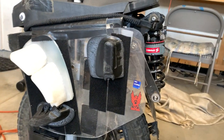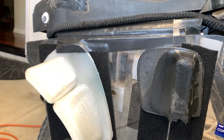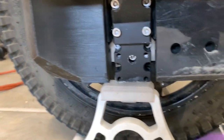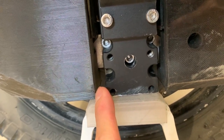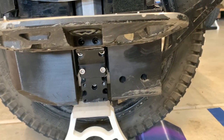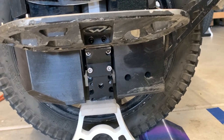My Master is now 100 millimeter travel suspension. The travel this slider can go through is 100 millimeters. I did that by swapping out the original Master's drive tubes to EX30 slider bars. You can see the metal underneath there — that's aluminum sheet that I cut into my battery mounts. This is a Master Pro pedal hanger with adjustable pedals. Right now I have it in the highest position, and I'll get into the performance aspect of this later — there are pros and cons to having it like this.